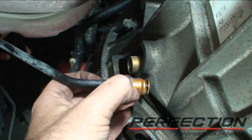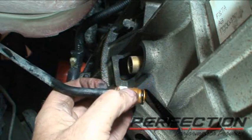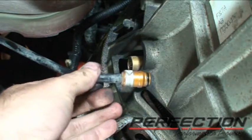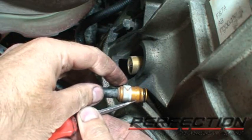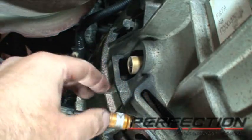That's a surprise that I got it out. The later sleeves have a big shoulder on the back end that makes it a lot easier to slide forward and push the tabs off of this shoulder. So that screwdriver kind of simulates a tab — the sleeve pushes forward and pushes it off, and then it can pop out.